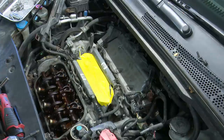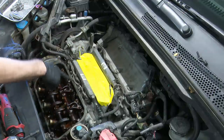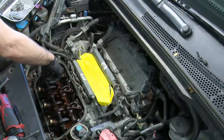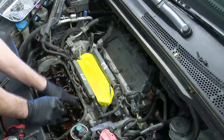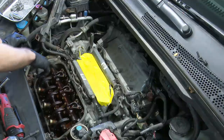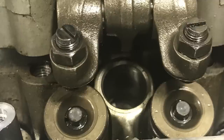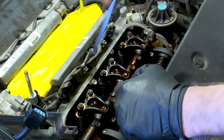Let's take a good look at what we're looking at. This side of the engine has the intake ports — this is our intake camshaft running here. Two valves per cylinder on these six valves are all on the intake cam. This side of the engine is our exhaust cam, right over by the exhaust manifold. What we're going to adjust is these on our intake cam and these on our exhaust cam. We're going to loosen this nut and take a screwdriver to spin these in or out to adjust that lash.